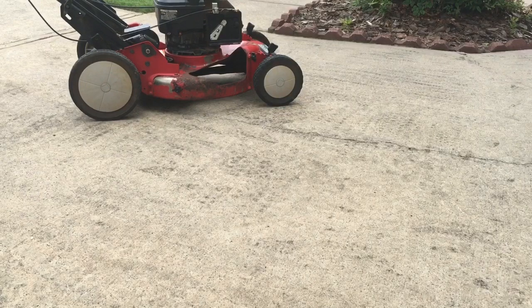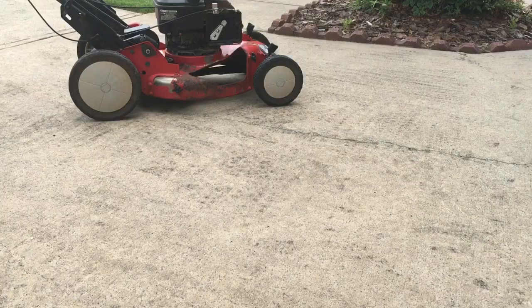Well, well, what do they got here? A running snapper. Reason why it didn't start, it started and died right away, is the throttle was turned down the whole way. So I used the throttle cable to raise it up so it'd run. I do have some concerns about that when it was leaking, but it hasn't leaked anymore since, it looks like I got the float finally settled up.